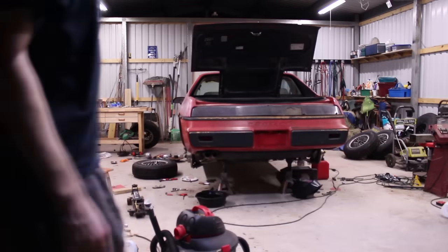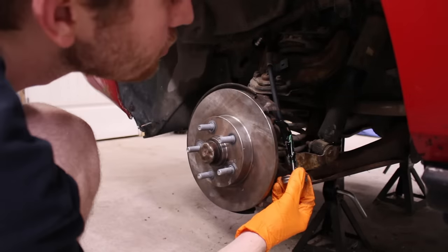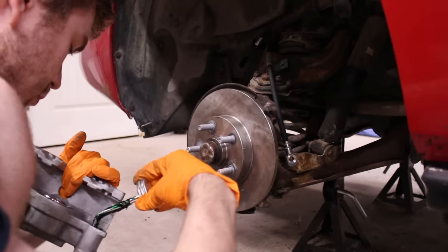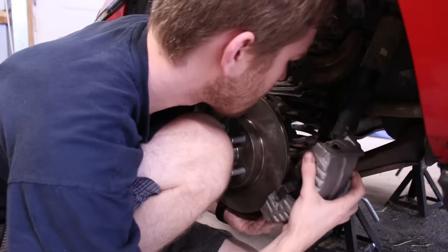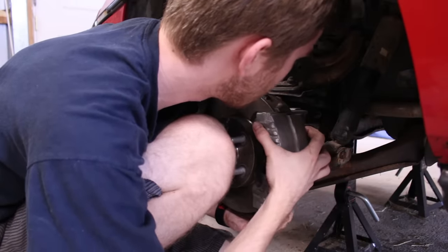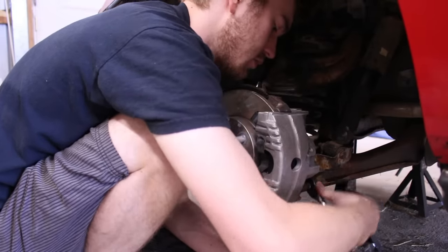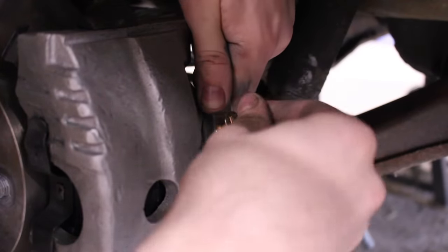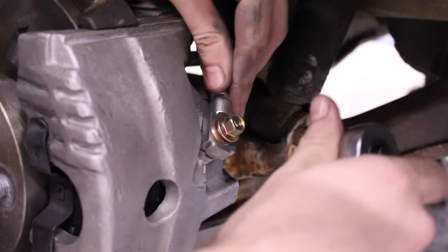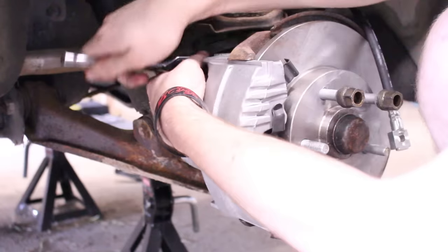To start the installation, the part of the knuckle the caliper slides next to was sanded smooth to get rid of any rust, and then brake grease was applied to those surfaces. After that, the slide pin holes got a liberal coating of grease, as well as the new pads where they make contact with the caliper and the piston, just to minimize brake noise. The caliper was bolted up with the new hardware after it was slid on. The rotor was sprayed down with brake cleaner earlier so the factory oils are completely removed — this was actually done as soon as I took it out of the box weeks before, which is why it already started rusting a little. The brake hose was attached with a new banjo bolt and crush washers. The bleeder valve was installed in the back, and then I was ready to move on to the other side, which was the exact same process.